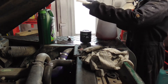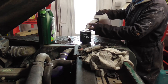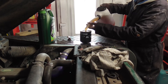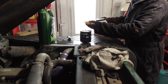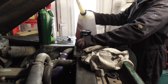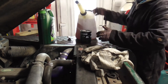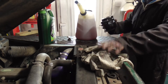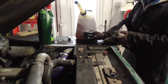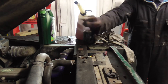I'm not going to put too much of this oil in this filter - just a bit, otherwise it's going to run all down my arm. I'm going to screw it back in place. You should really fill the filters up with a little bit of oil before putting them back on - it's not always possible unfortunately. Back under the car now - don't fill the engine up until you've put the sump plug back in.